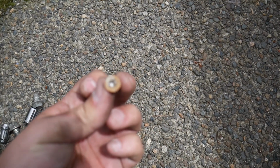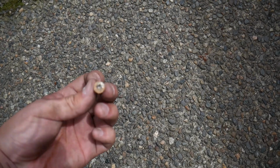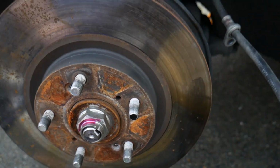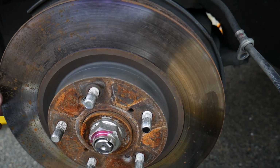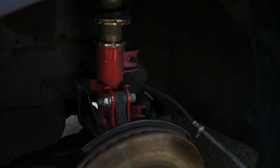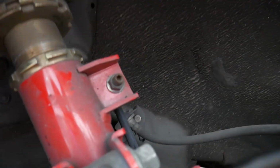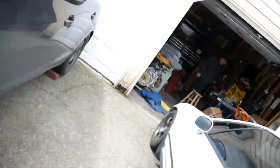But there you can see I got the screws out right there with a little bit of help from Dad, because one of them started to strip out. That guy right there. You see it's not focusing, but yeah, it's stripped out kinda. So I'm gonna just run with one of those. Technically, you don't even have to use any of them because your wheel will be pushed up against here, and when you tighten down the lugs, it'll keep the wheel and the rotor on. But after you get those taken off, your rotor can just pop out. Kinda hard doing this with one hand. There we go.